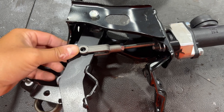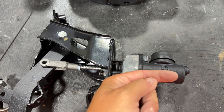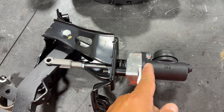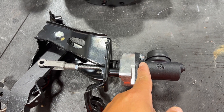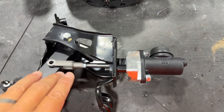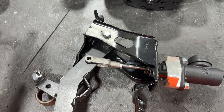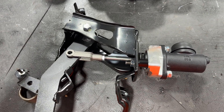This is also important to make sure that you have free play in your pedal as well. This master rod goes in and out of your cylinder, and towards the back there's a bypass valve. That bypass valve is what relieves the pressure out of the system, so you need to make sure that this master rod is able to return all the way out to zero position.